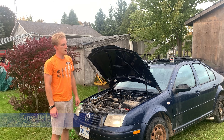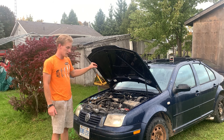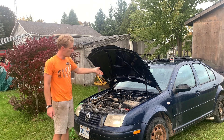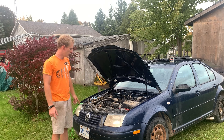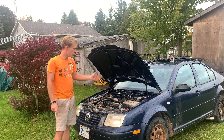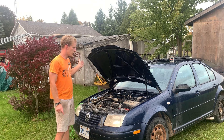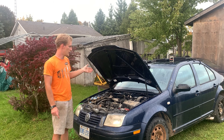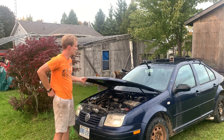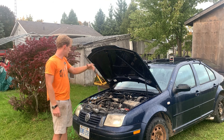This is the second part of the windshield and windshield wiper video. Today we're going to show you how to clean the ground that's underneath the cowl, which is important - if you ever have any issues with the windshield wipers where they're twitching or they don't stop, that ground is one of the causes. The other ones are under the battery which we'll maybe do in a future video. We're going to use dielectric grease on the motor plug, show you how to install the pieces with torque values, and then put the plastic cowl back in - which is the hardest part of this job without breaking the window.